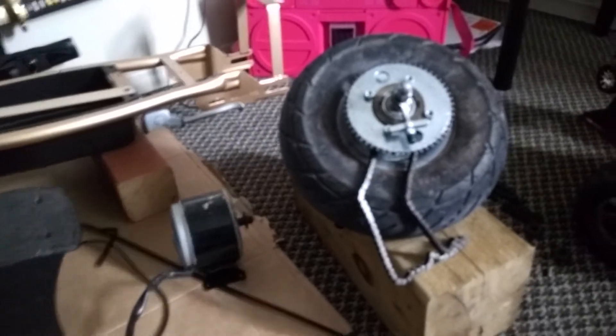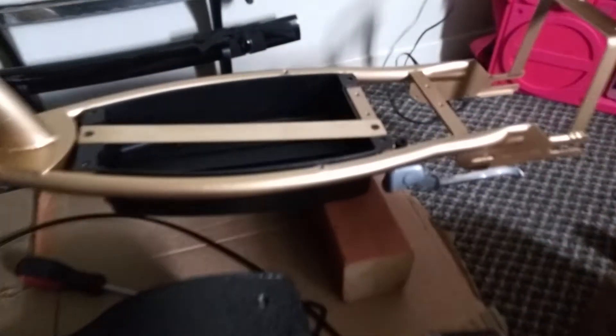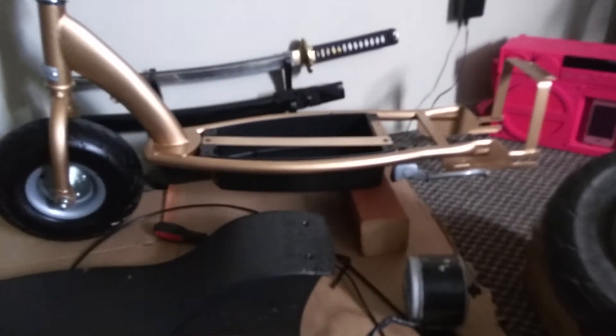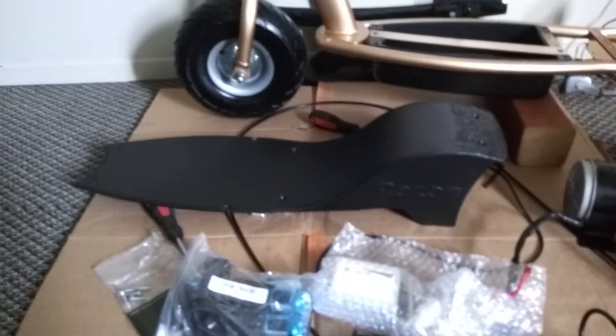What I'm doing is actually going to get a brushless in-wheel motor for the back there, and I'm going to drop in a new speed control. I'm getting all new throttles and everything for the top, and an LCD screen telling me how fast I'm going. Once I'm done this, it'll be a real professional, nice scooter and it'll go pretty good.